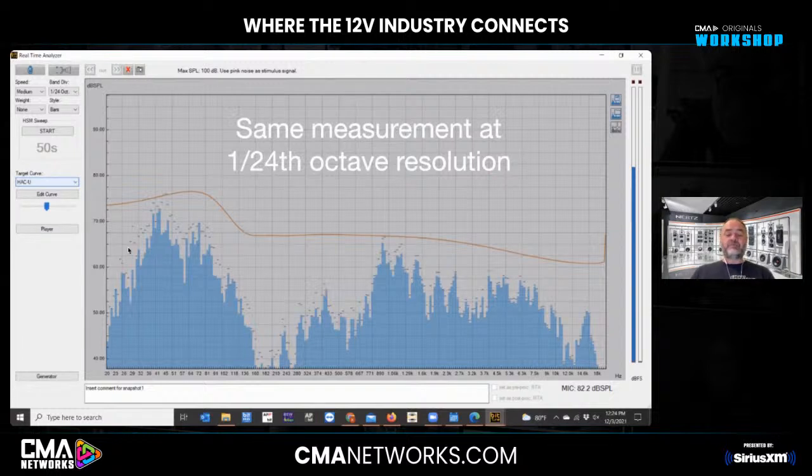It turned out that this was a BMW, one of the newer BMWs where the amplifier and tuner are in one module and the crossovers are on all the time in that module and can't be defeated. And it turned out that the installer who did this car had preloaded a BMW file that was made for cars with a full range signal, one of the older BMWs. So this signal right here was essentially the result of stacking two sets of crossovers on top of each other. I could have tried to EQ this till the cows came home. I wasn't going to solve that big problem at 160, 180 hertz.